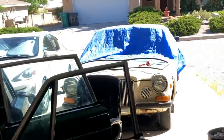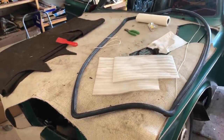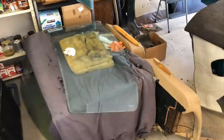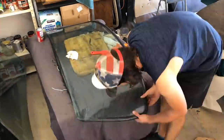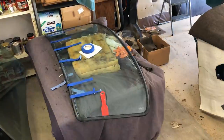That was not good for my carpal tunnel. The thing's got to just sit in the sun and warm up because it flows so slowly. Be careful getting it on your skin though — it won't burn, it's just tough to clean off. It's basically liquid tar. So I'm going to attach this windshield gasket to the windshield, and some of the goop will settle, and then I will call a helper and we will set it down here where it will be roped in. You saw I was spraying the paracord with silicone spray — that'll help it slide out of the rubber. Getting the gasket on is kind of nerve-wracking because it really fights you a lot of the time. It's real tight on there. My biggest concern was the sides pinching together so much that it creates a crack right down the center or on one of the corners of the glass, because this glass is 50 years old after all. But it worked. Finally.